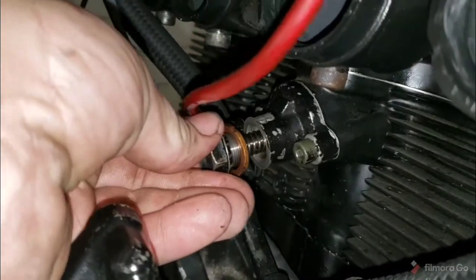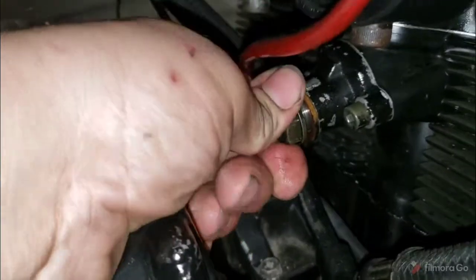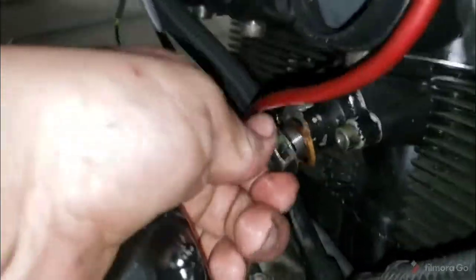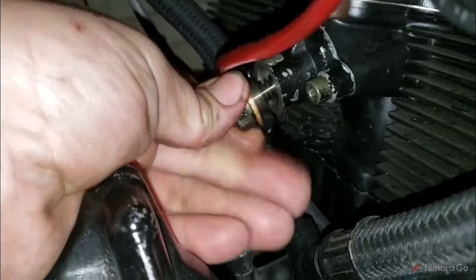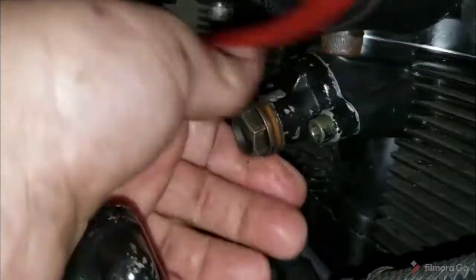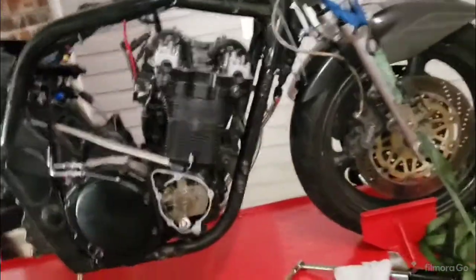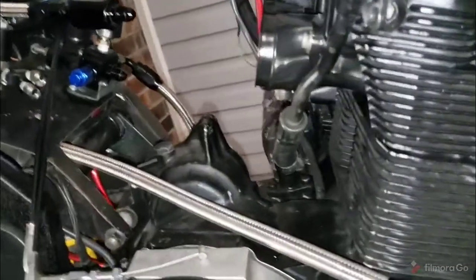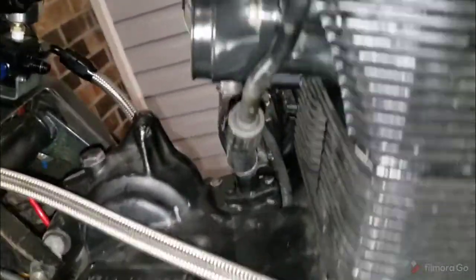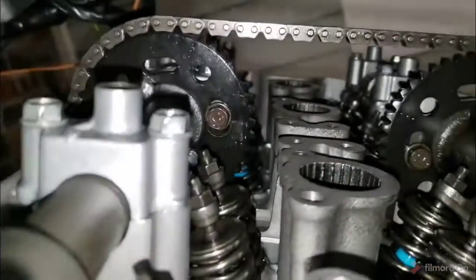So as you push this, you heard that zipper. Oh God, this is the part that sucks, especially offhand, one-handed. And it doesn't need to be tight yet. All right. Now, number one rule when timing any engine, never use the starter until you know. So we're going to go ahead and verify our timing. You're going to see the slack start coming out of it, and you're going to hear the clicks.